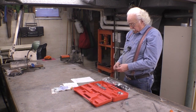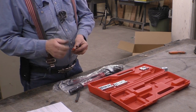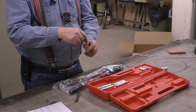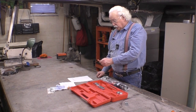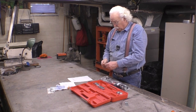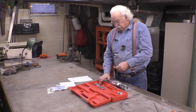What's important is how you fasten the cables. There's a bunch of ways to do it — I've seen you stick the cable in and hit it with a hammer, which actually isn't all that bad. I've seen where you take a vice grip, heat the cup up, fill it full of solder, and stick the wire in. But what you're ending up with is a cold solder joint — the wire's not hot, so as soon as the solder hits it, it's cold. Crimping is actually the best way to go.